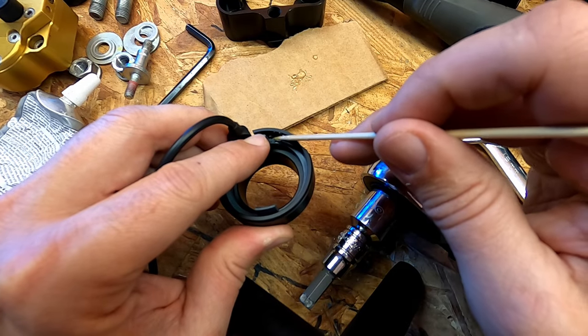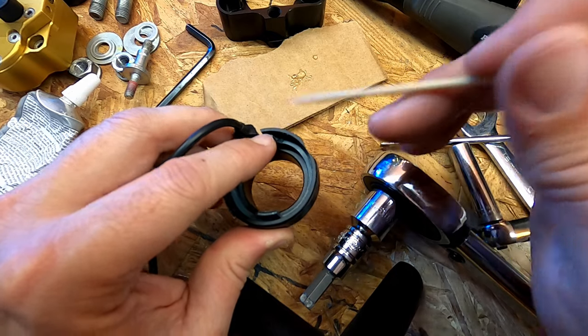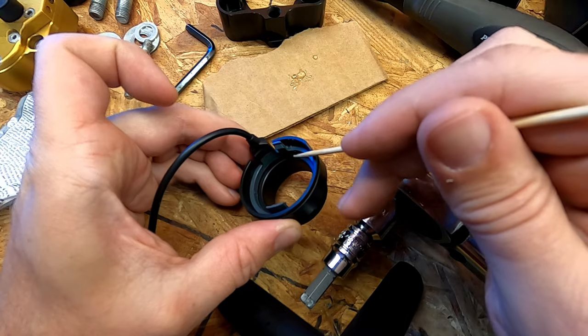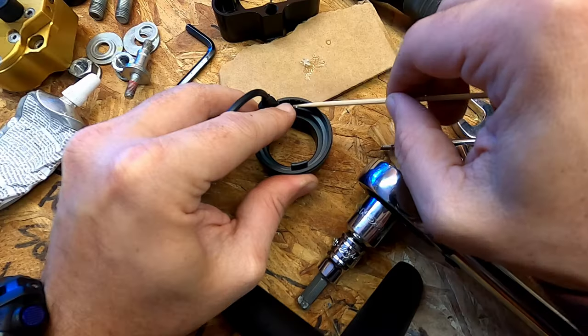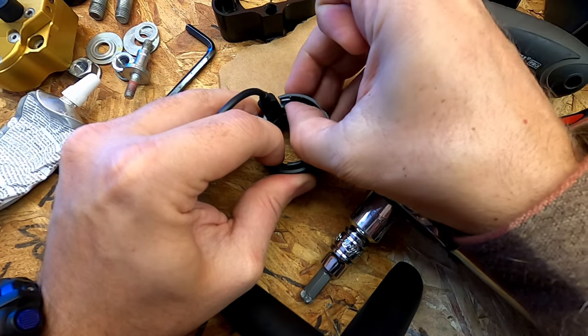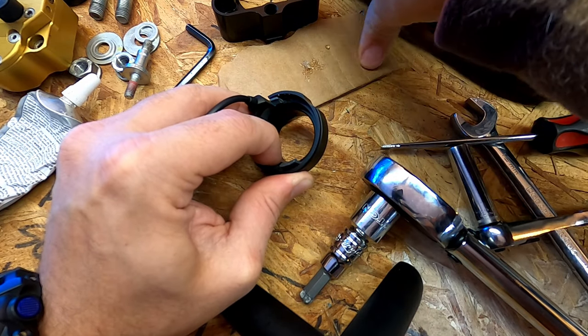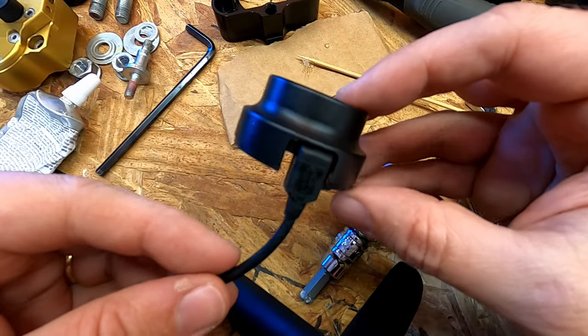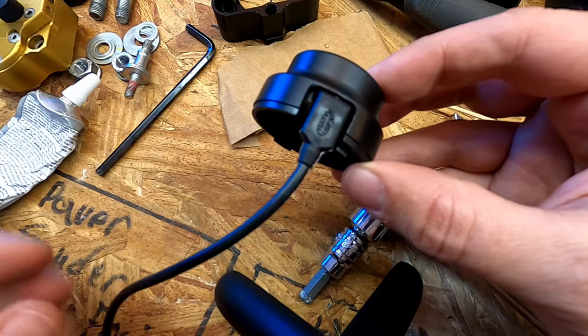All right, the E6000's kind of dabbed all over where that crack was. I don't see any other spots. This side's totally fine. I think it's because of this little guy. Just wedge it all down in there, spin this thing around, and then push the tab back to sort of pinch it all shut. That'll take 24 hours to dry to waterproof, but within 30 minutes, it'll be pretty well set up.